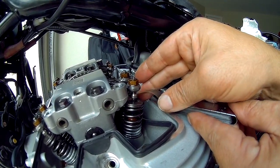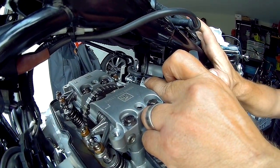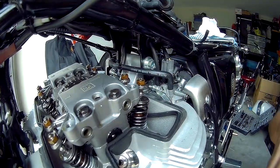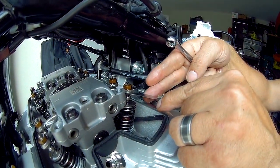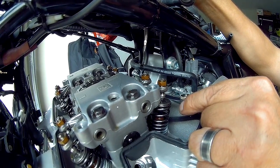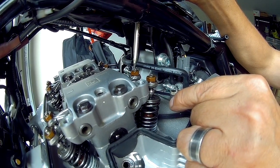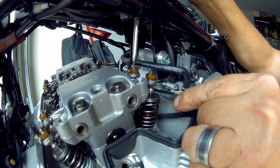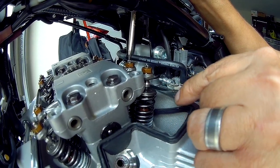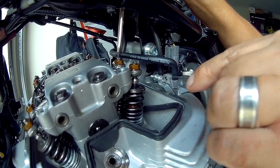So I'm going to adjust that one, loosen it off a bit, using our 10 millimeter, about a quarter of a turn, just to loosen off the lock nut a bit. I know that's a bit too loose. Basically, you've got to do a little adjusting, a little checking, and your adjustments are only going to be like an eighth of a turn, if that. Okay, so I've adjusted that a titch, and again, you can hear that, you can feel it in the feeler gauge. So I'm going to keep that right there,